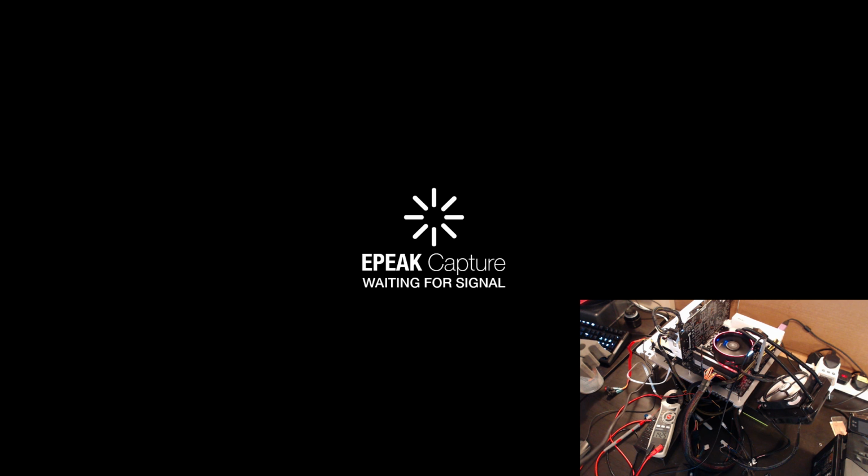And it threw an error. I should probably drop it back down under 4 gigahertz because it's not fully stable at these settings right now. Oh, yeah, it failed again. Can't get into Windows, so I'll have to drop the core clock. Hopefully it's not a memory issue. It might be. Hard to say when it crashes after the... and that's an F9.